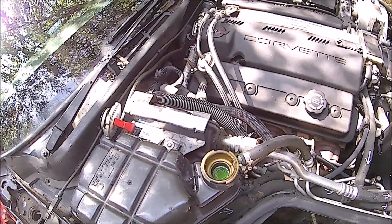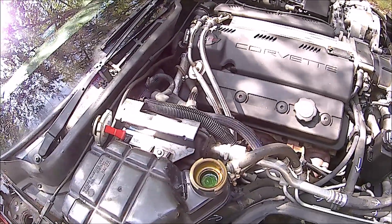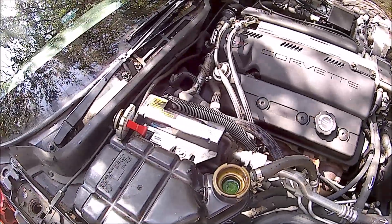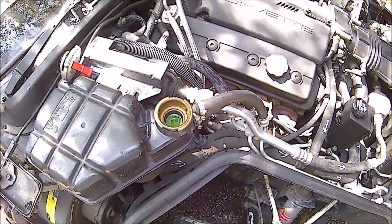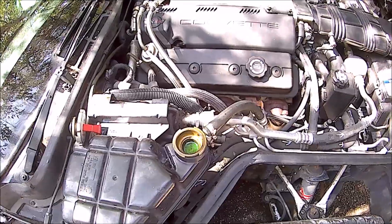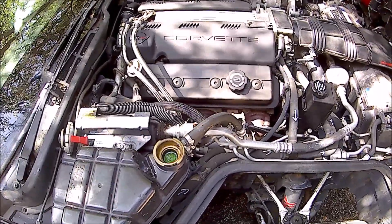I'll take it on a drive and use my antifreeze tester to make sure we have an adequate amount. As long as I have at least three balls floating, I'll be fine - that's down to negative 10 degrees. In Missouri, I don't think it ever gets anywhere near below 10 degrees in the wintertime. We are running slightly more water than coolant, but I got some concentrate left and can always add it or drain a little and add some concentrate. But that's boom done - that is how we flush the coolant on our '93 Vette, reuse the same 160-degree thermostat, and get rid of that Dex Cool and roll green. Thanks for watching, boys. Peace!